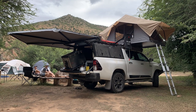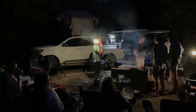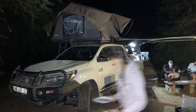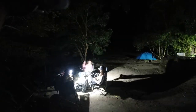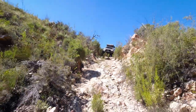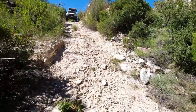Now you know, so you don't have to make the same mistake — look at the National Luna battery box with a built-in charger. How long does this whole thing last when you're leaving lights on, leaving the fridge and freezer on, opening them all the time, charging phones and cameras? It lasts longer than you think. With the 105 amp hour battery — and with the other one tethered making it about 140 amp hours — I've gone for three full days and battery capacity is still around 55 to 60%. If it's below 50% you want to stop because you can damage your battery, but honestly I've never really gone below 50% as long as I drive a bit every now and again.